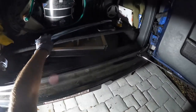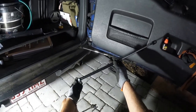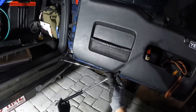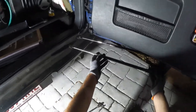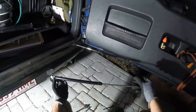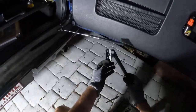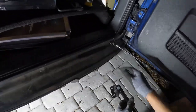So what we're going to do is replace the gas strut. We jumped on eBay and found this — $24 and shipped within a couple of days. Amazing. It comes with a little bracket on one side and a little open tube on one end, so it pretty much sits in like that. It's 550 mils long and a direct replacement. All it is is two 10mm nuts on the underside and one 8mm bolt on the top bracket on the boot side.